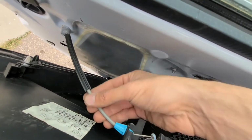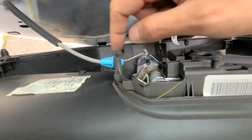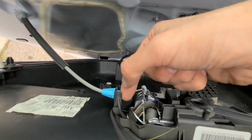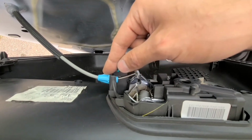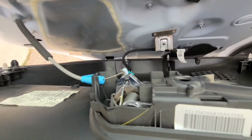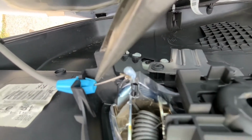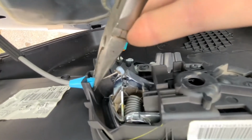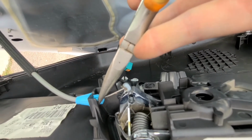You have to find this cable inside your door panel, and then first, before you put it into this hole, first you have to attach this metal piece right here, and then put the left side in. But I will now detach mine and show you what you have to do. If yours comes like this as well, you will just have to use this kind of pliers. You'll see it has like 2 pins here, which you have to push, and then you can pull out the cable with your other hand. I can't record it because I have to use both of my hands to do this.